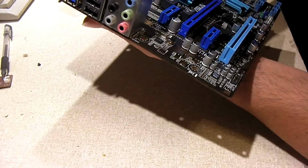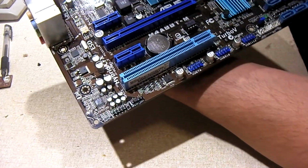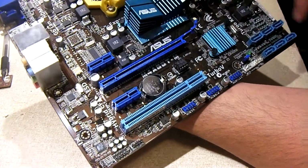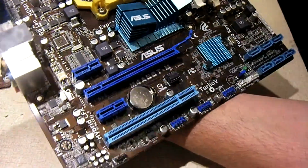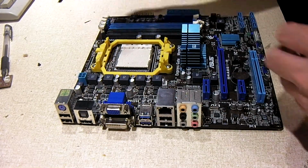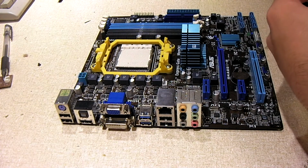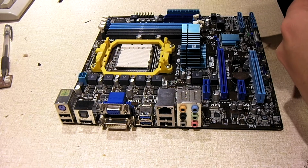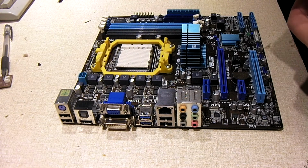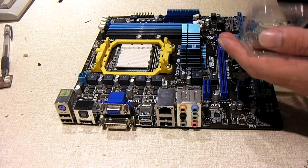Okay, since I forgot to tell you guys the model, in case you hadn't already noticed, it's an Asus. So, I'll go ahead and install our CPU. And one thing I've noticed funny about this board is that it claims 140 watt CPU support. That's a pretty major claim considering this just has a 4-pin CPU power header. Yeah, I would be more comfortable with an 8-pin power header in that kind of case.